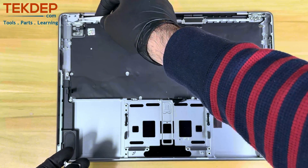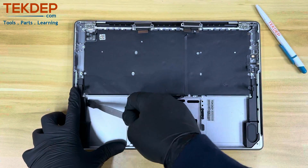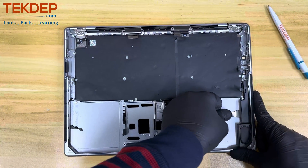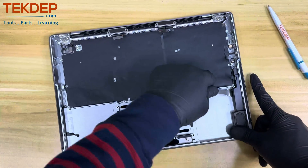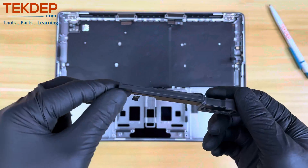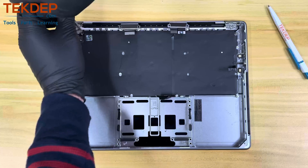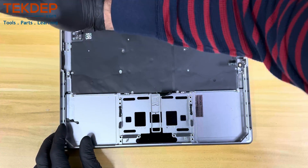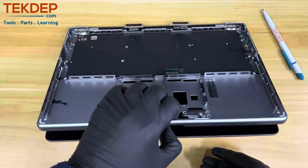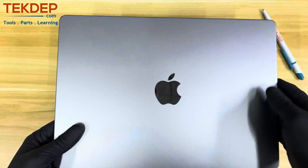Take the Wi-Fi module out and examine the design. Using your tweezers, get both hinge covers out of the way. To remove both speakers, flatly slide your metal pry tool between the speaker and the chassis — speakers are attached with a special type of glue, so use some extra strength but be careful not to break them. If you need any parts or tools used in this video, find all links in the description. To remove the entire display from the chassis, remove the six T9 screws — that takes some muscle power. Open the LCD to a 45-degree angle and apply some downward force; the display comes completely off.